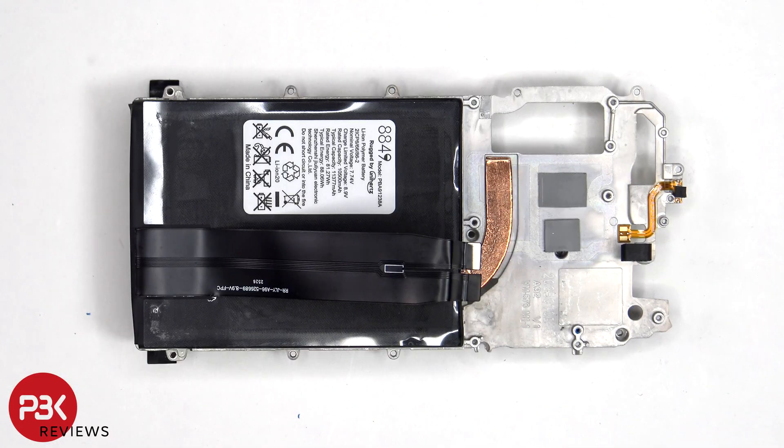As far as the battery assembly goes, there are multiple batteries which are soldered together with the controller board on the bottom, which add up to the 23,800 mAh of capacity. However, if you look at the label on the battery, it may show a different amount, but that's only because the voltage on these batteries is different than standard smartphone batteries. So if you calculate the voltage on these batteries, you do get the advertised 23,800 mAh.